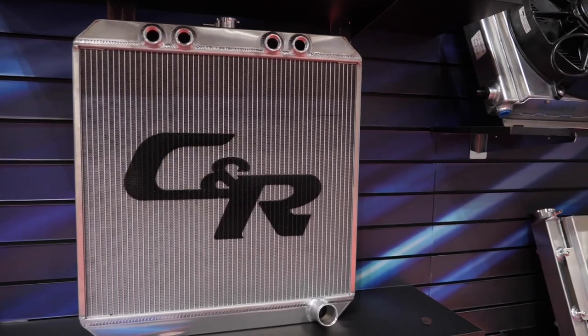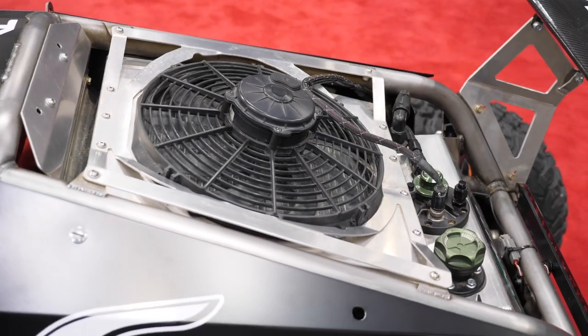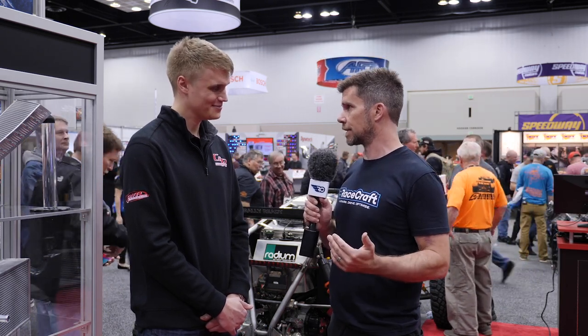When adding an oil cooler, it can be tricky with modern cars to find room at the front, and some people fit the oil cooler in front of the radiator. Can that work? It can work in certain applications, but we typically recommend against it because you're essentially taking some of the cool air you would use to cool your coolant, using it to cool the oil, and then potentially heating up your coolant with the air off the back of the oil cooler. If your oil temperature is north of 120 degrees C, the air coming out of that oil cooler is going to be quite hot, reducing the effectiveness of the radiator.